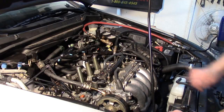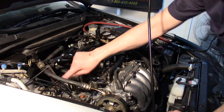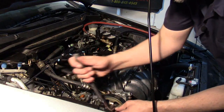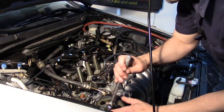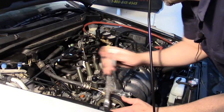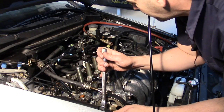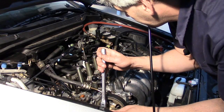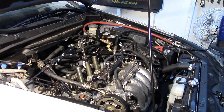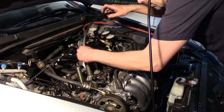I've got an additional complication — I still haven't removed the timing chain here, so I've got a little support so my timing chain doesn't bind up. That's also going to be important so that if the piston does move with the compressor, it doesn't tangle up my timing chain. We just passed top dead center there, so I'm going to find true top dead center — right there should be it — and the piston shouldn't move on us. Then we'll put in our hose.